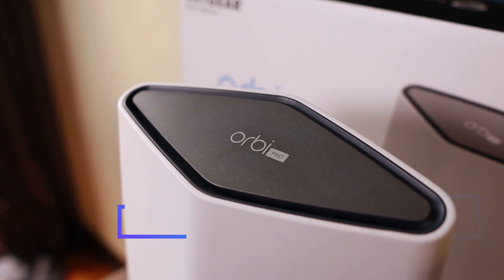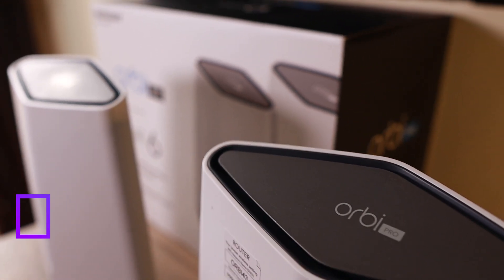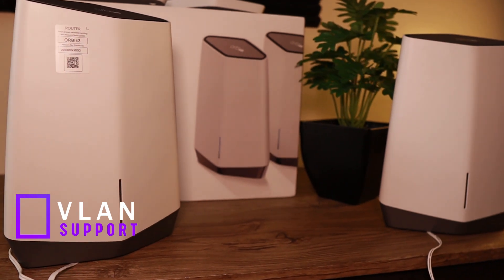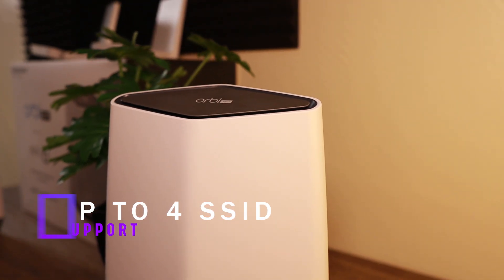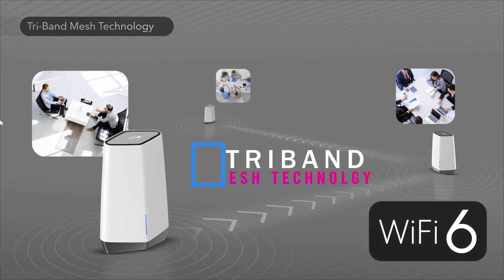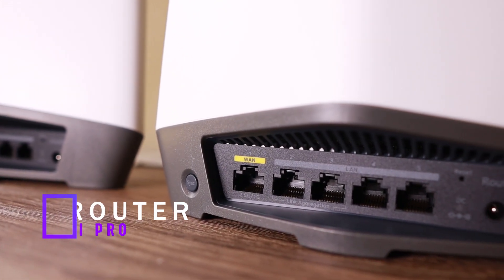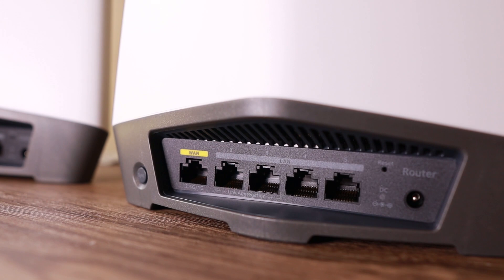These devices give you up to six gigabits per second throughput, enhanced security features such as WPA3 — the highest level of wireless authentication — support for VLANs, and you can create up to four SSIDs to separate categories of users. It also features tri-band mesh technology that keeps you connected even as you move between devices. At the back of the Orbi Pro router you have a WAN port that can reach up to 2.5 gigabits per second and four gigabit Ethernet ports for wired devices.